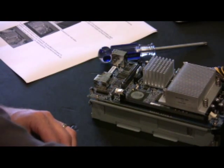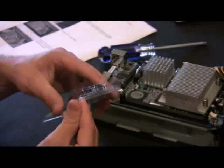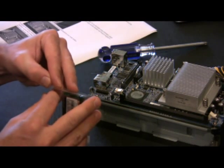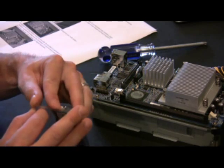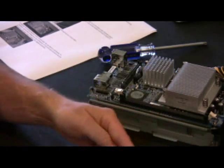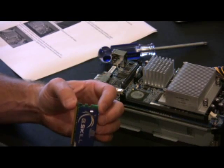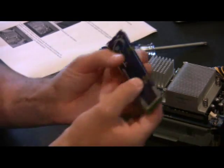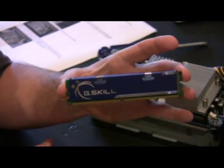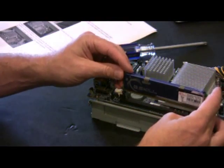So now we're going to take our brand new stick — our G-Skill, which is a PC2-5300. It is 667 MHz and it is a 2-gig stick. I'm going to go ahead and keep that memory tray. You can see that this one has got a nice heat spreader on it, so all those add-ins will be cranking and our memory will be able to stay nice and cool.